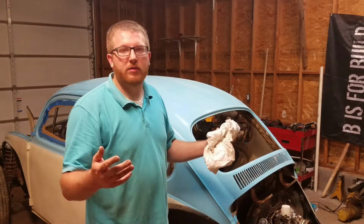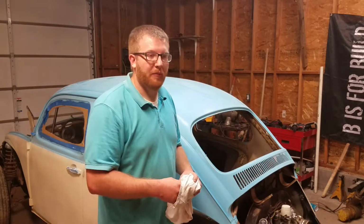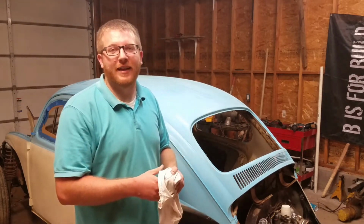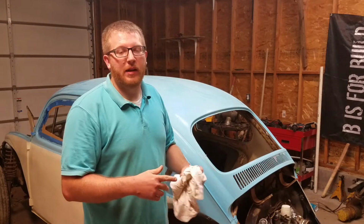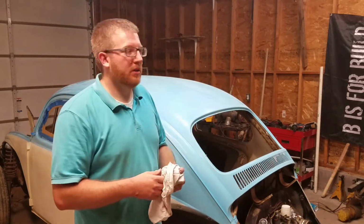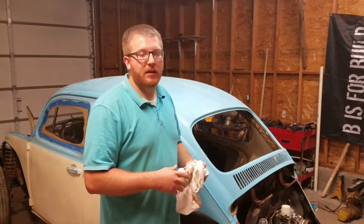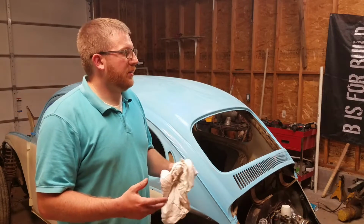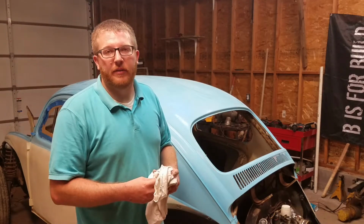Alright guys, that's how you remove a front window. Make sure you plan on replacing the gasket because you might have to cut it out. Which was way easier cutting it out, peeling off the outside and be able to push it. And once you saw there in the clip, the rest of the gasket actually came out with the window once the initial window was moving out of the space.